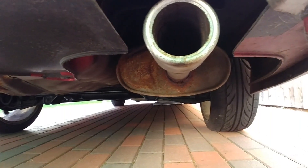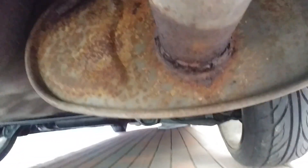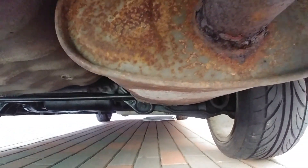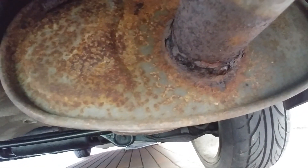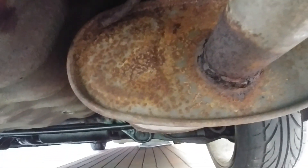If you watched episode one when I was revving the car up just to give you an exhaust note, you might be able to see this. Look how bad and rusty and welded this is — you can't even see further back because it's much, much worse. I can't really get underneath it because the car is a bit low, so the whole exhaust system needs to be changed. This is a mild steel exhaust and it's not even the right exhaust for this car.